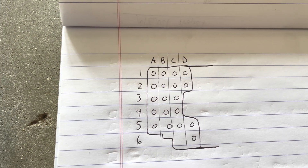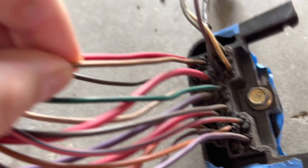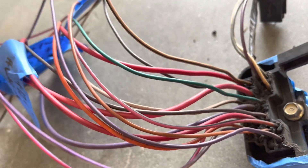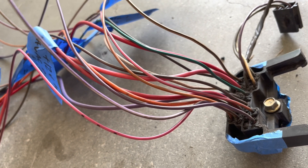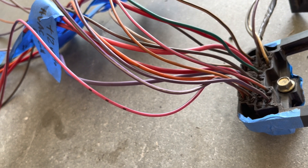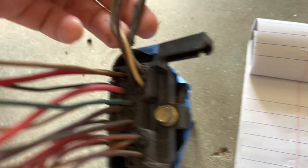The first one at A1 is a red wire — that is your constant 12-volt from your battery. B1 is a tan/light brown with a black tracer, and that is basically GM's diagnostic wire. It was used to go to the ALDL on the inside of the vehicle — it's basically their diagnosis system, which is now the OBD2. It's an old diagnostics connector.